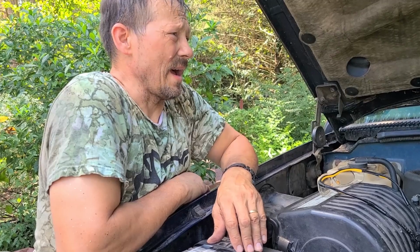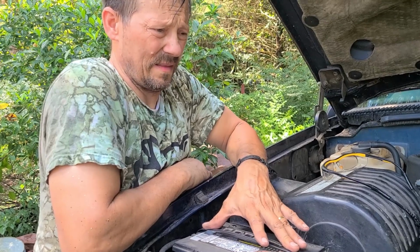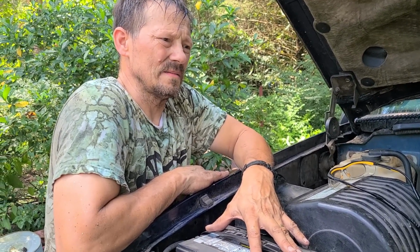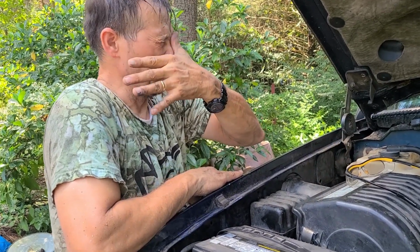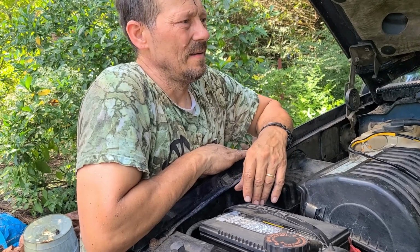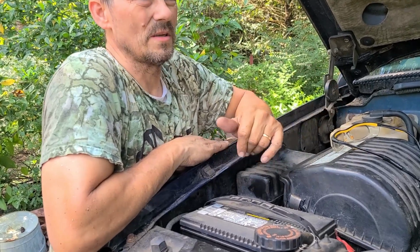I guess the gas is probably okay, because a lot of people said this ethanol blend fuel actually lasts longer than the other gas, so it's not necessarily the gas problem. But the fuel pump could be acting up, or the vent in the tank is another thing I could check. Maybe it's got trash and it can't return, so therefore there's no pressure.